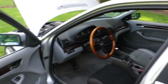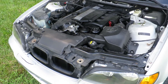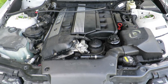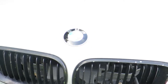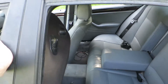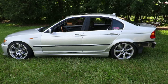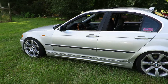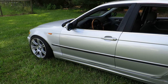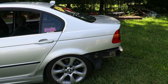Otherwise, as you can see, the car is mostly stock. It's been great to me — the car's got about 160,000 miles on it now and maintenance-wise it's been pretty good. Definitely go ahead and replace your cooling system if the car is new to you. I've had zero issues — the car's never overheated once, and I beat on it every day. No smoke, no burning oil. So if you're looking for a good beginner platform, definitely recommend an E46. They're very simple, very reliable, easy to work on, parts are relatively cheap, and now that drifting's becoming such a big scene, more and more angle products and bushing kits are becoming available. If you have any questions, leave them below — I'd be happy to answer. Any recommendations or information you want in another video, just let me know and I'll make it. Thanks.